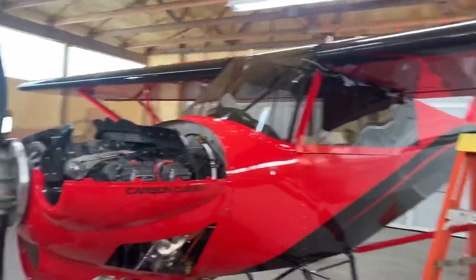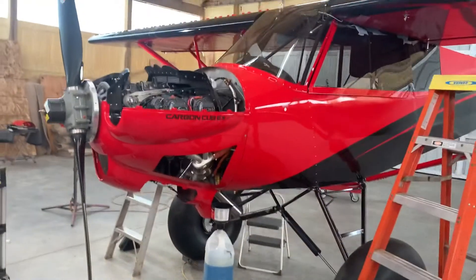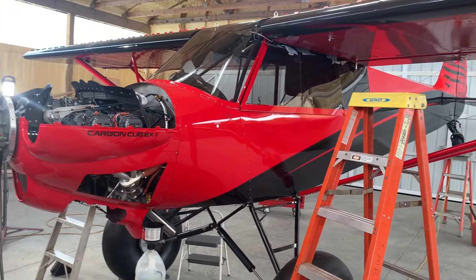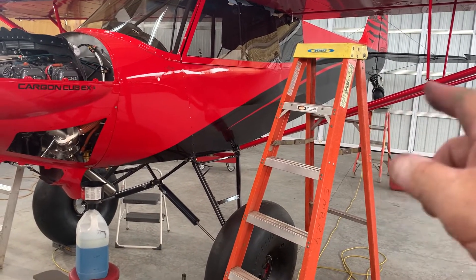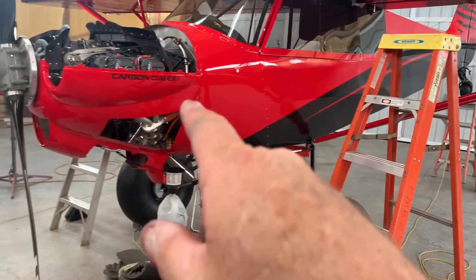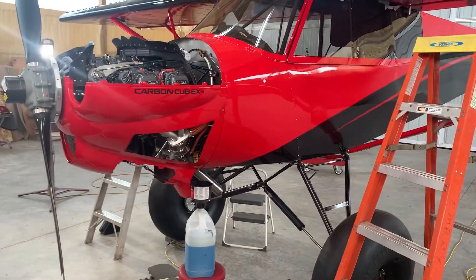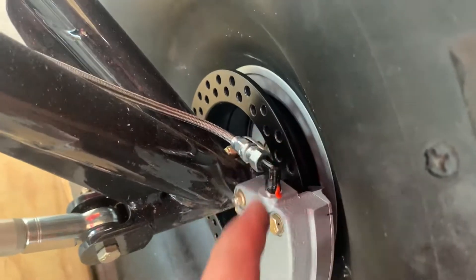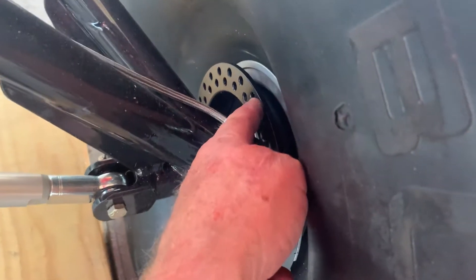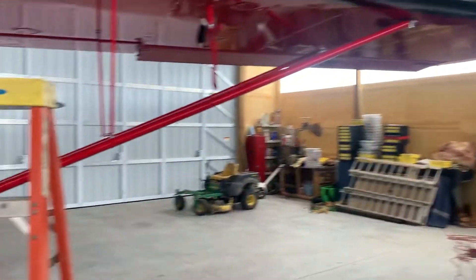The last thing I'll do is probably today or tomorrow — go out and start the engine. I'll run it the least amount of time necessary on a new engine. You don't want to idle around too long. I'll start it, run it up just until it's running nice and smooth, then shut it down. I'll check everything for leaks and make sure it's good. Then I'll taxi about a half a mile down the runway to the fuel pump, dragging my brakes the whole way to burnish them in and burn the paint off the rotors. Just lightly drag those brakes all the way down to the fuel pump.